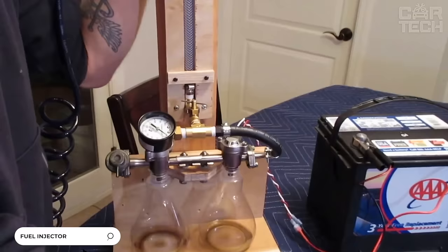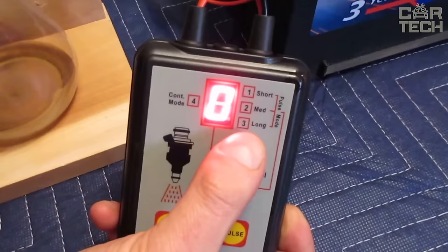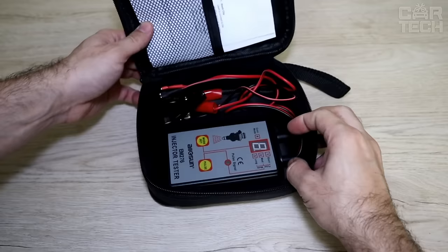The next product is a small compact injector diagnostics and cleaning stand. It is a station that is connected to the battery. The injectors are then connected and pulses are applied to them. The device delivers pulses with different frequencies until the injector is cleaned. The kit contains the tester itself, power cables, and nozzle mounts.